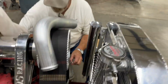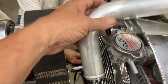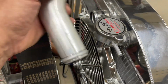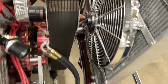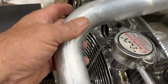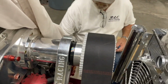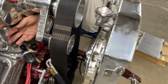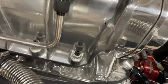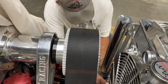So we have the radiator hose coming around. Going to plan B. Plan B is we got an aluminum tube. It's an aluminum radiator. We're going to take and cut the tube. I think I'll have Daryl do it, and we'll come around because this is way too sharp a bend to make with a hose. The kind of hose we had. Oh, it's right here. On this hose it wouldn't have worked. We had to use a little rubber thing here, and it already had a bend in it. It wasn't awesome.